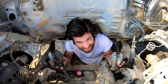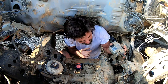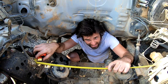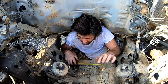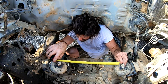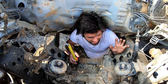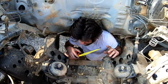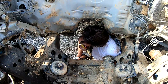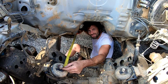Alright, I'm here in the engine bay of the Tacoma now with the mounts. These guys are made to hang right in here — they kind of sit right in place. The first thing we want to measure is the distance between the shock towers: 28 inches. And I'm also really concerned about the distance between these mounting points — about 16 inches in width. Those are going to be big determining factors as to whether this thing is going to bolt right in easily or if we're going to have to make some changes. The other thing I want to measure is from this mounting point back to the transmission cross-member mount — roughly 34 inches.